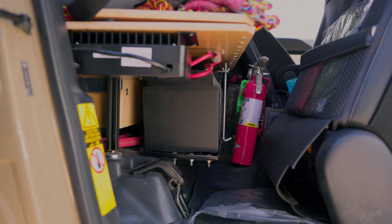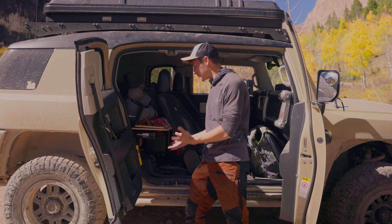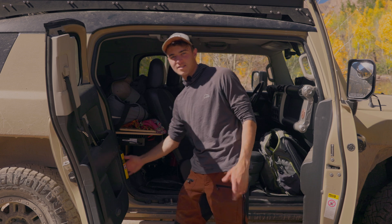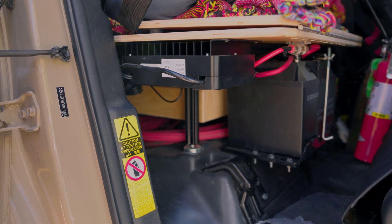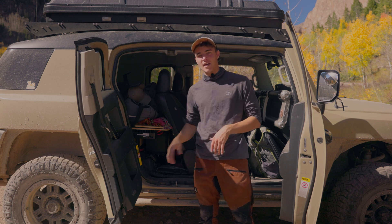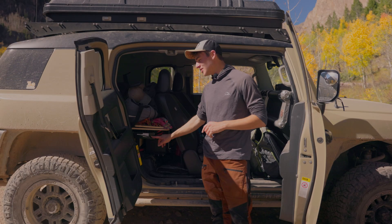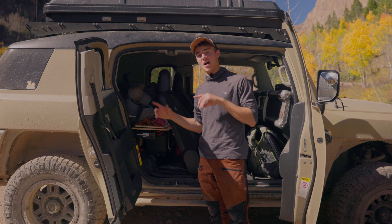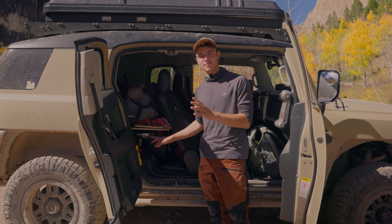There's a little flap that hangs on the front because this is a sleeper system — you can fold it out and sleep on it. There's a little area up top where the drawer system doesn't go as far, and it worked out well to mount all the components. The wires run in from the wall, hidden, and go into my 30 amp DC to DC charger. This is what essentially stops pulling from your starter battery — as soon as your key goes off, it only pulls from the secondary battery, letting you drain it without affecting your startup. The cool thing is this charger can also run solar, which I'm not using now but could add later. Honestly, I really don't think I need solar — this thing charges incredibly fast.